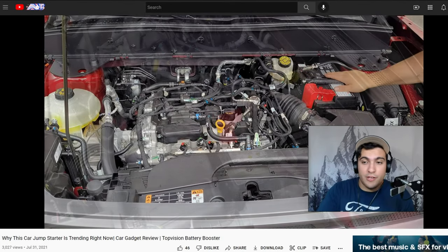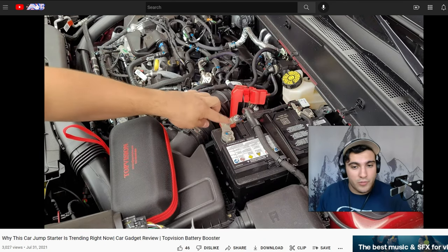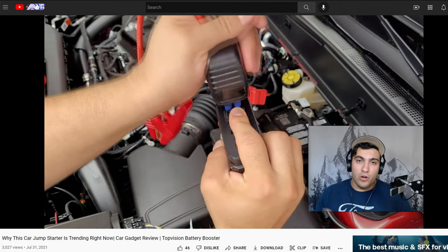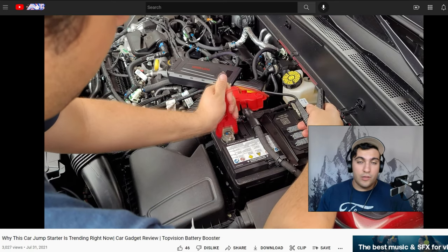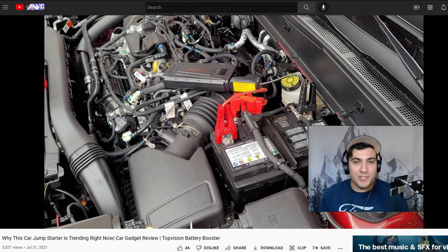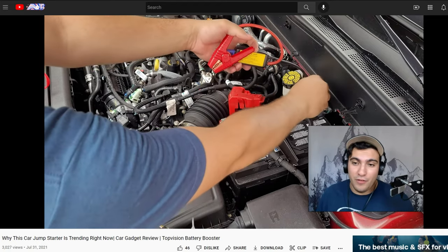Lastly, we'll be checking out how to jumpstart our car. In the interest of time, one of my most popular videos is a review on Top Vision's Car Starter — that video will take you through what the device comes with, how to use it, and how well the device works. But right now, I will quickly run through what we are doing in this clip: we are taking the car jumpstart along with the jumper cables and hooking it up to the car's battery, following the correct polarity — positive to positive and negative to negative, or red to red and black to black. Check your manual for further instruction. Once we have that set, we can power on the device and crank the engine. The car will turn on, and once it does, we can disconnect the device from the jumper cables and the jumper cables themselves, and we're all good to go.